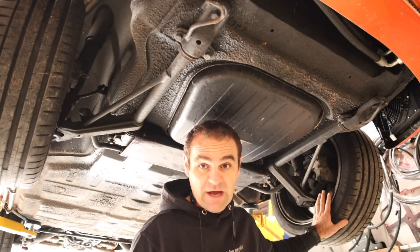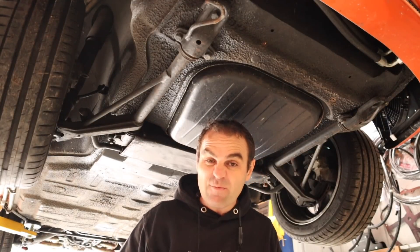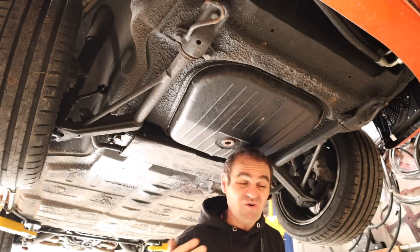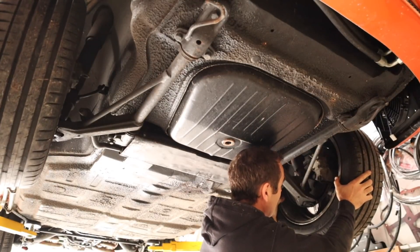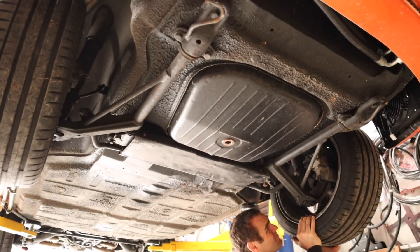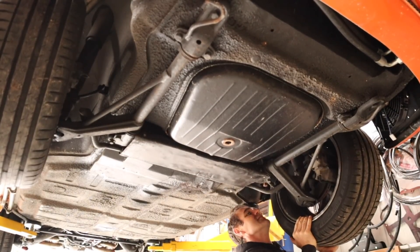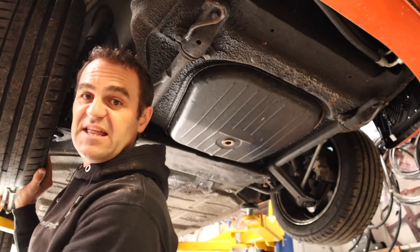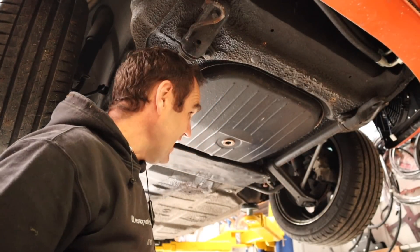While the car's on the hoist, another thing I wanted to check was a clunk coming from the front corner. One of the good things to check before a road trip is wheel bearings and looseness — by jacking the car up and just rocking the wheel you can feel whether there are loose bearings or anything. There's no clunking with the steering shaft, everything seems good in and out, but if I do this — it's quite loose in here. Something is loose, so that's going to require further investigation. The other side is fine.